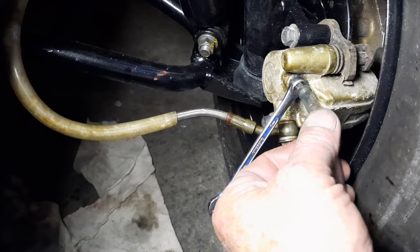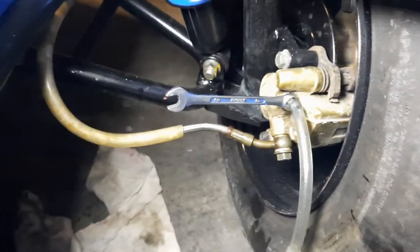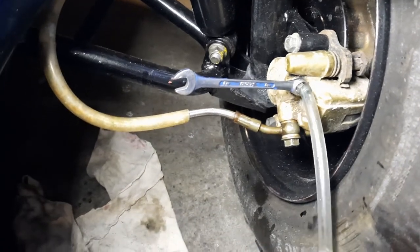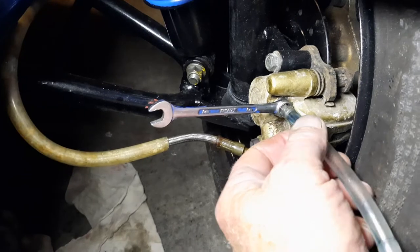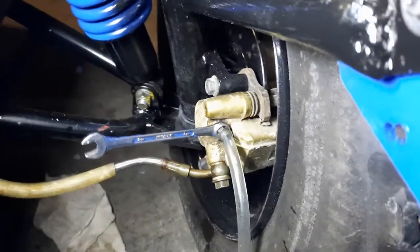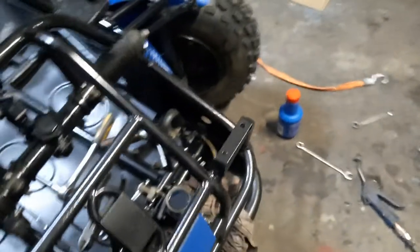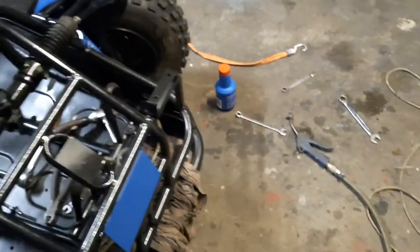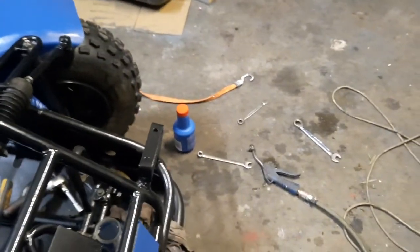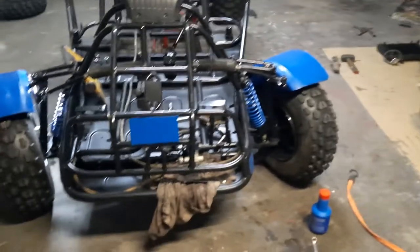That air just came in around the hose because I'm not holding it straight. I'm going to have to drop the camera and check that again in case any got back in there. But basically it's bled. Normally you'd have two hands on it. Always keep checking your master cylinder — if it runs dry, you'll suck air into your master cylinder and basically have to start over. Anyway, just a quick tip — hit the like please!